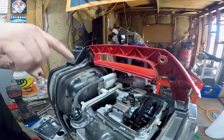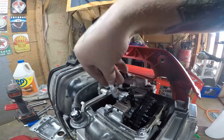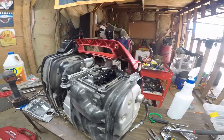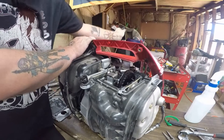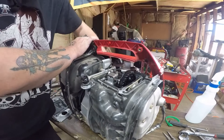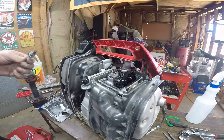I'm going to put my safety glasses on because I'm going to spin it, and on the compression stroke it might shoot up all that fluid. I can put the spark plug in. I just want to see if this valve moves now. Okay — it's down, it's back up. All that stuff is getting pushed around in there and cleaned. I would say that's a successful unstick job.